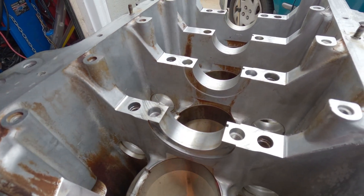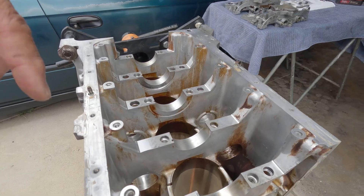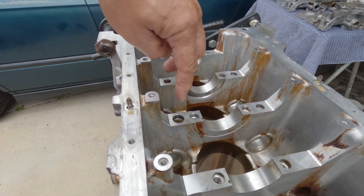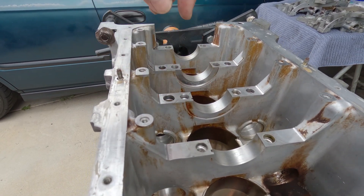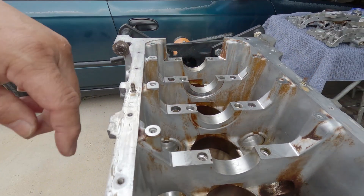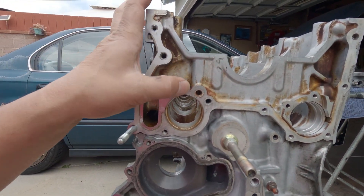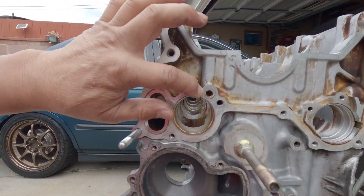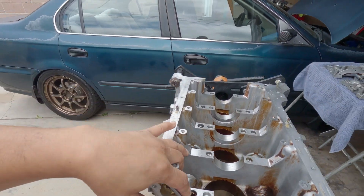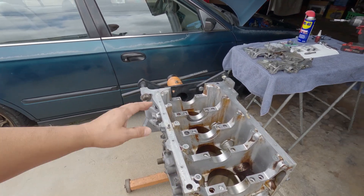Today's episode I'm going to put some plugs on all those oil ports — the galley for the balance shaft gearing. The first is the sixth of them: one, two, three, four, five is the one that goes all the way down — it tapers down. I have to be very careful that I plug the correct one way down there in the bottom. This will be the sixth one, and the oil supply for the oil pump which is for the balance shaft gearing is right here.